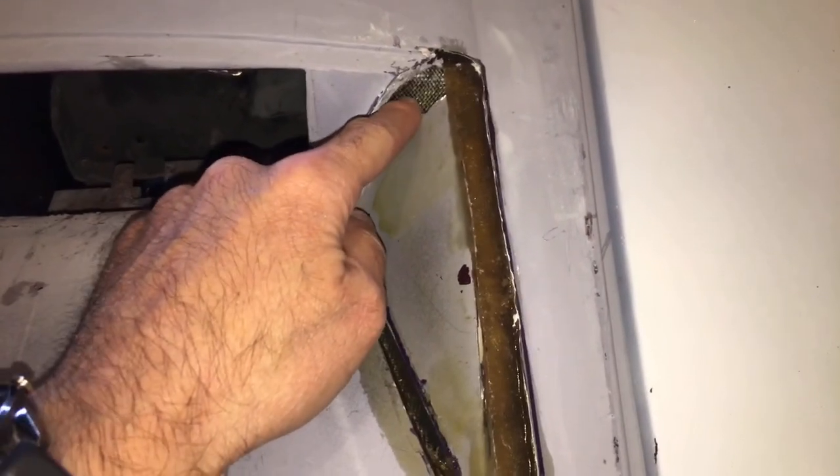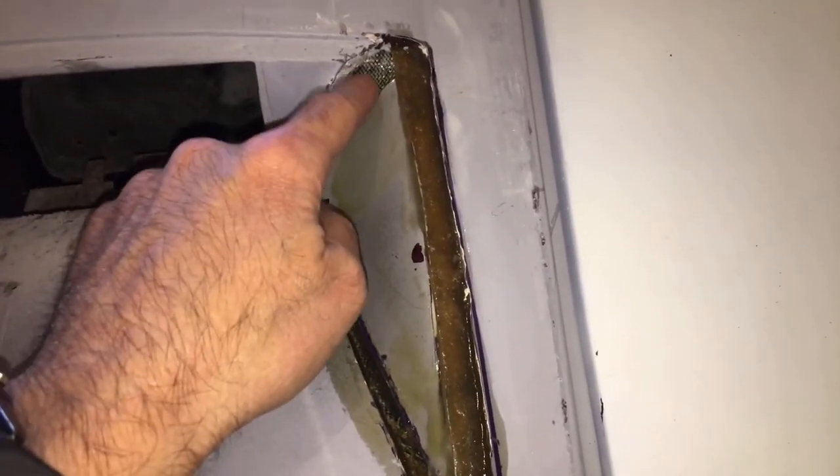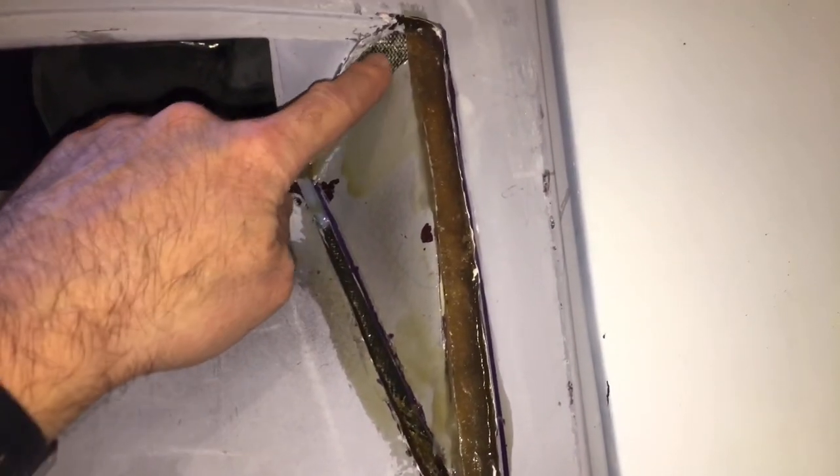Let's go on to the other side - it's looking really good. Same thing there, you can see the fiber. What I did is I put a coat of resin here where I routed it to smooth it out - you can see it's a little jagged right there, but we'll smooth that out. Here's the line for the pop-up headlight - right in line with that. We'll have the nice black trim and it'll look great. This is not for any kind of structural purpose - the only reason why I put this fiber cloth back here is so that when we put the body filler in here, we have that foundation for it to lay against, so that way it doesn't crack or fall through or break with any stress. That way we have this foundation so we can really put it in nice and thick and make it nice and solid. I'm going to go ahead and start applying that, and then after that we'll be able to sand it and give the primer on it.